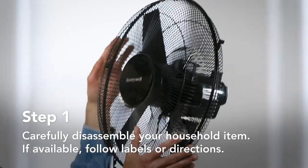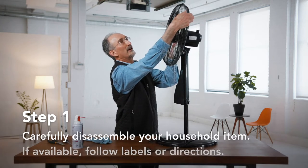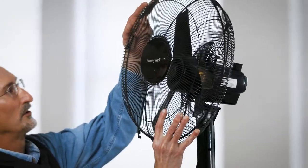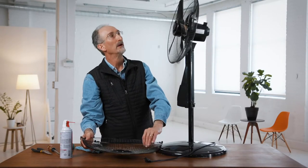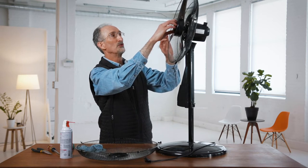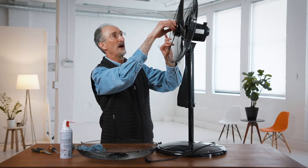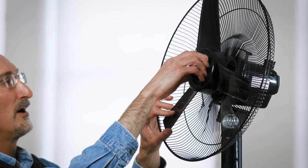This one is fairly easy to take apart. The cover comes off by taking these clips around the outside where the two pieces come together. You take the front cover off — there are large models and small models very similar to this. Remove the cover, and then there's the fan blade assembly. Because the fan blade goes in one direction, this is counterintuitive, but the nut that holds the blade on actually turns the opposite direction — in this case it turns clockwise to take it off.